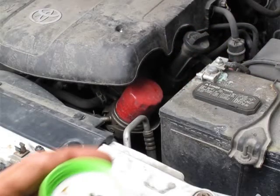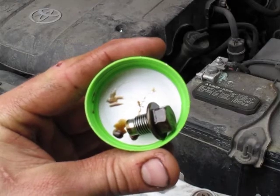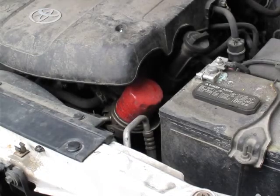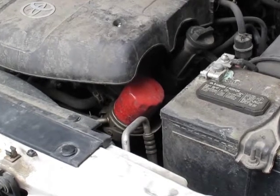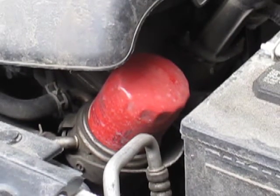Alright, here we are in the engine bay. Here's a pro tip to keep your drain cap out of the dirt: take the lid off your oil bottle and just drop your drain cap in there so it doesn't end up wherever. Now we're going to locate our oil filter - here it is. It's really easy to find on these particular vehicles, but I've seen them in all kinds of dick-around places. Taking a couple of minutes to set up the camera has let the majority of the oil drain out.